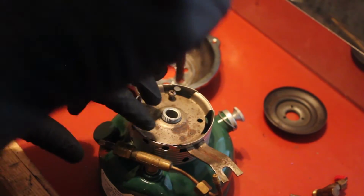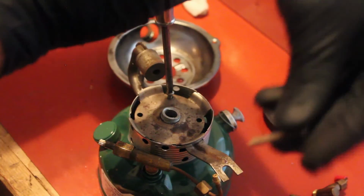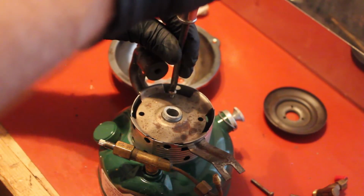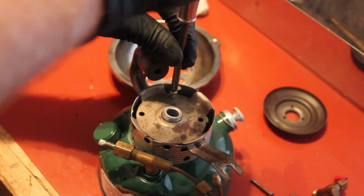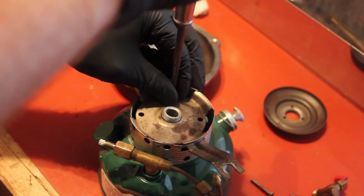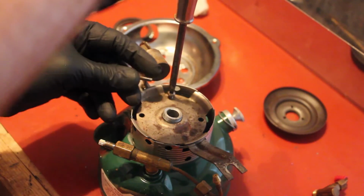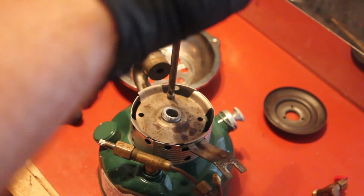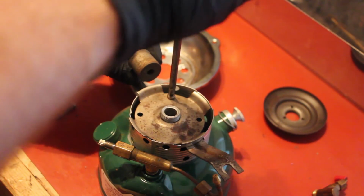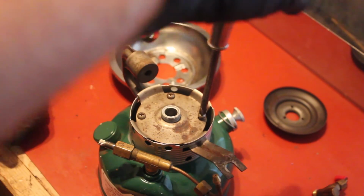Focus. A pro reassembly tip: anytime you have something where you do not want to strip the threads out, or you have fine threads, as you do on this, before you start turning clockwise, turn to the left or counterclockwise. Hear that click? Do it again here. Hear that click? That's actually what you're looking for, because that's the tip of that thread engaging with the threads in the hole, and that will ensure that you never cross thread anything in your whole life if you follow that one simple rule. There we are. That one was pretty loud.